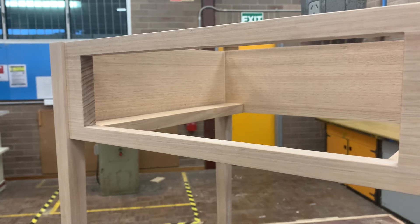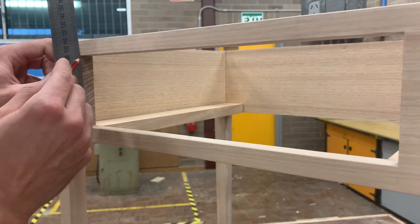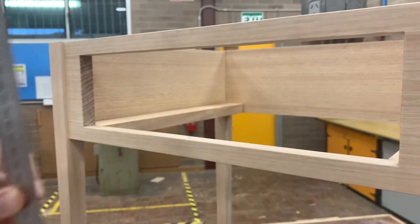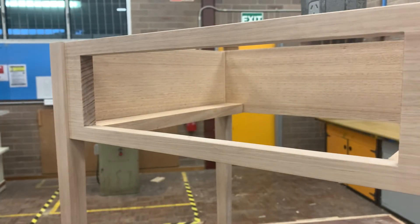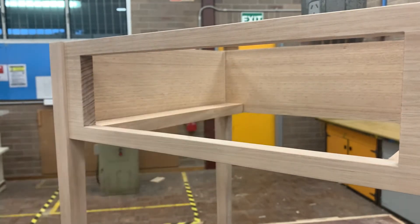We're here and we're marking up for our drawer. The very first measurement you're going to require is how tall your drawer is going to be. I can see over here that's sitting at 92 and that is sitting at 92. So the max height my drawer can be is 91 millimeters, because you need gap for movement. I'm going to jot that down — 91 millimeters.